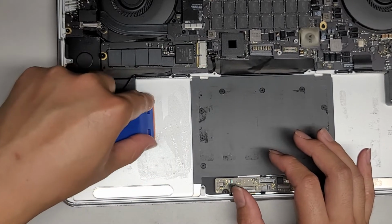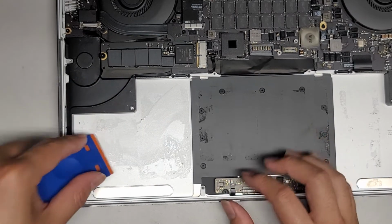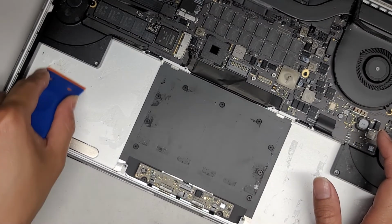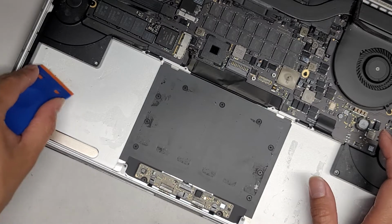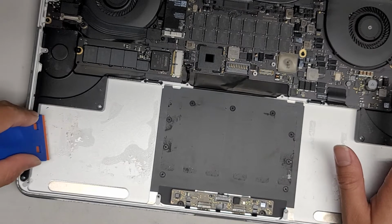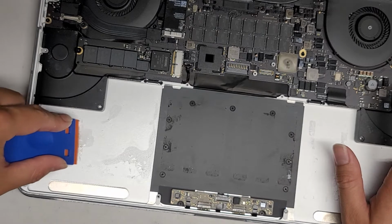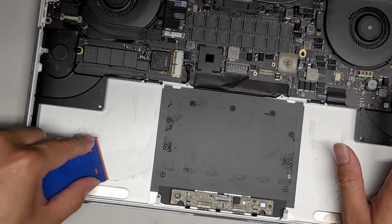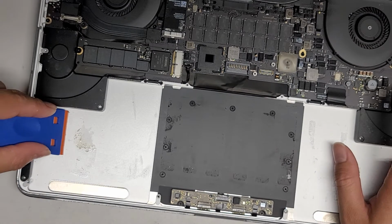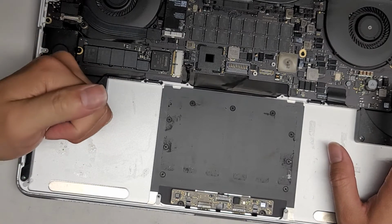Okay, and the rubbing alcohol just dissolves all of that adhesive residue. So we're basically just going to pull the isopropyl alcohol over there. And isopropyl alcohol also isn't electrically conductive. The only thing is there's water mixed in it, so it's not 100% rubbing alcohol, there's water. So keep that in mind, and that's why you can't just pour it all over everything. If you dry it out before you turn it back on, you'll actually be okay. But again, just to be safe, I don't like getting this stuff into all the electronics. Okay, so we're gonna just try and get that there to dissolve it.